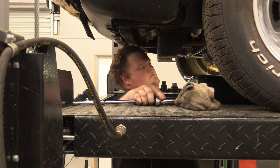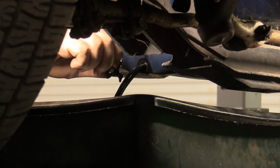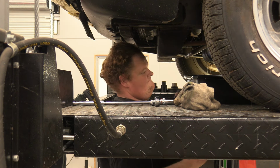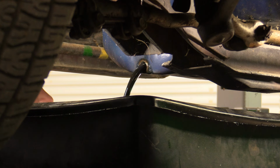As I've said before, the distributors were usually a dual point distributor. Another thing about them is they had a baffle in the oil pan, and most of the Cobra Jets that I've seen, not all of them, but some of them that I've seen, I should say some, that will get the guys that are going to tell me why I'm wrong about it, a lot of them have 4-bolt main blocks. So it is a more special engine, but it is also a low compression engine. This has not got the same cylinder heads as the regular 4V M code in 71. The Q code's got the low compression, unleaded fuel cylinder heads that they went all the way through 1974 on this particular engine.